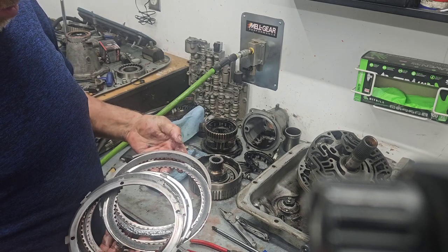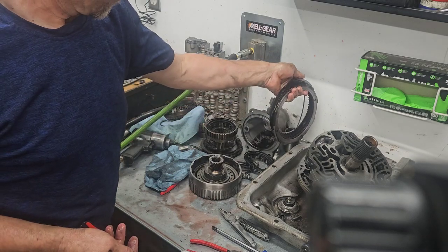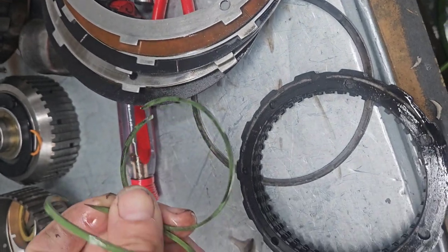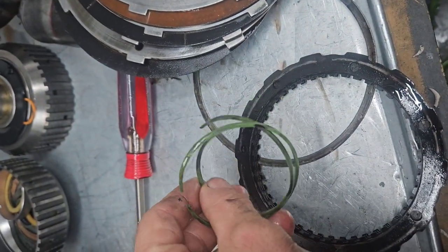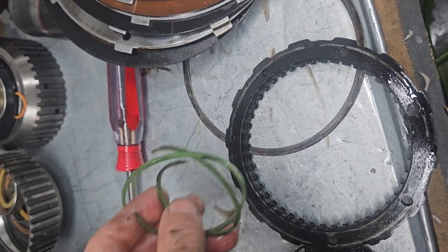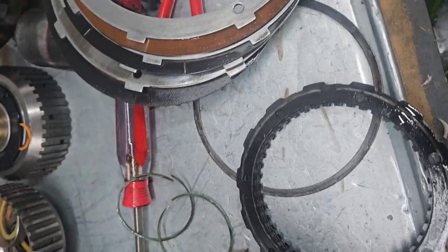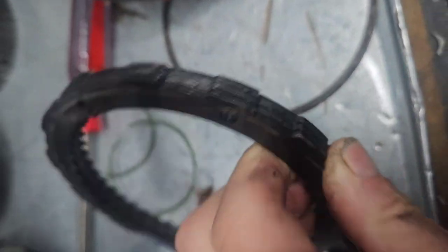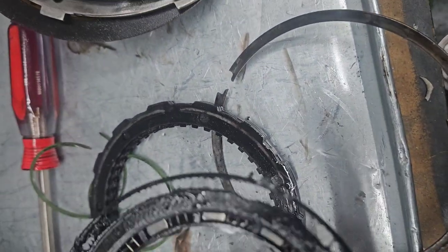Look at that, cooking it. And here's why it smoked. We've got these seal rings from Transgo that are supposed to be better high pressure ones that failed. Not super enthused with that, but it welded this clutch pack together. Got it so hot that it shoved the snap ring out. It melted